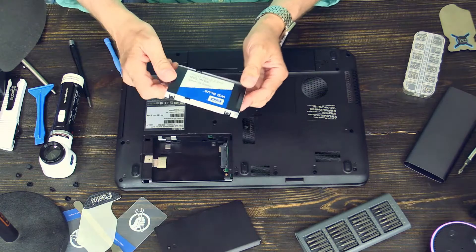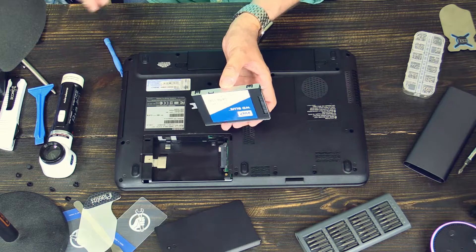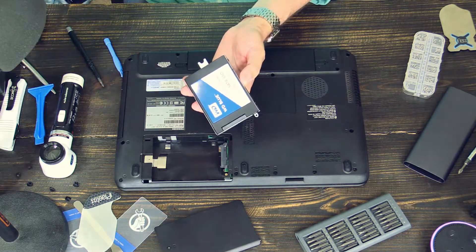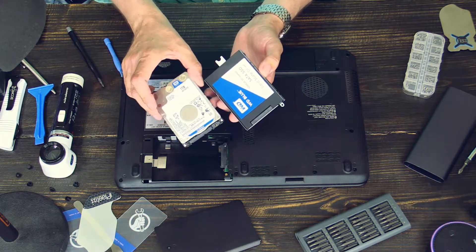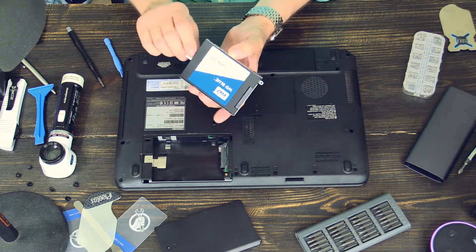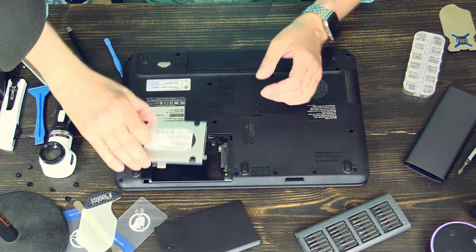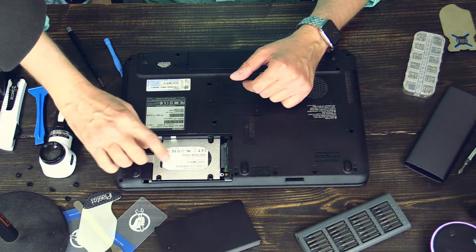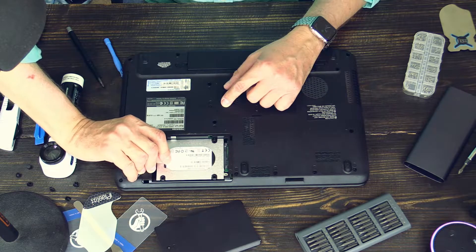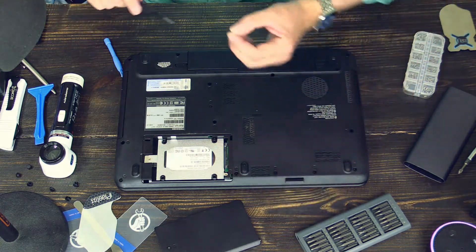And of course, you see the cage here around it — this metal thing. You have to transfer this cage with the screws: remove the screws on each side, two on each side, and transfer the cage to the new hard drive. In this case, I already did that. When you have transferred it, it's very easy. Take the whole hard drive — here is again the latch — place it into the computer like that. It fits very well. Take the latch and push it into the opposite direction until it clicks in.